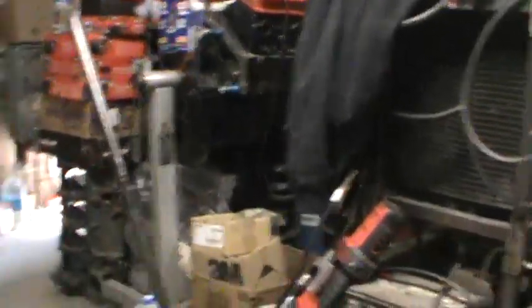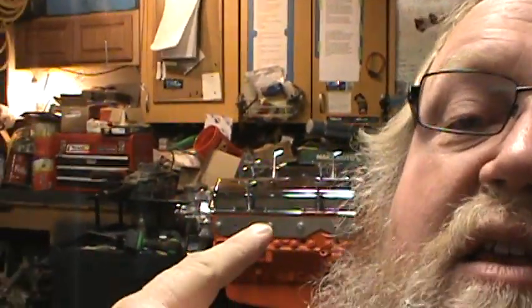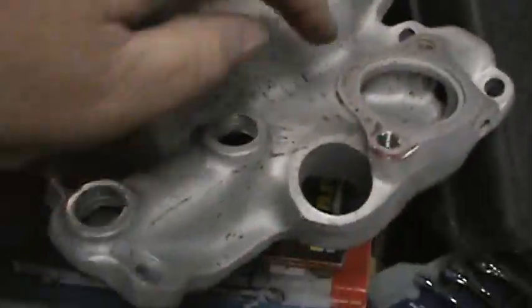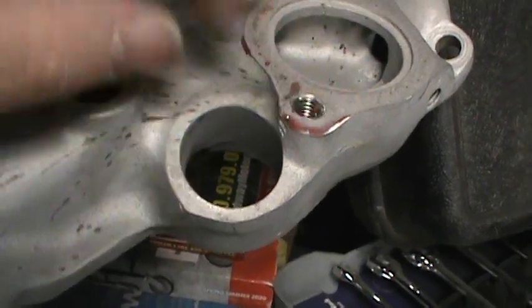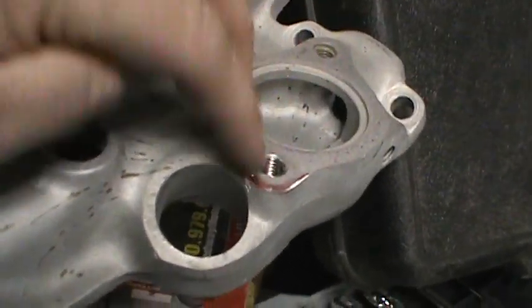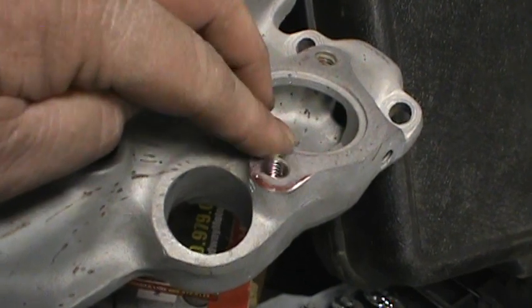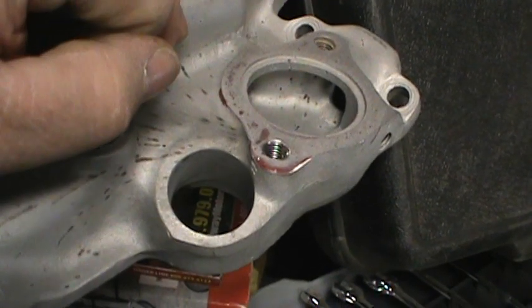I thought, well, I can sit down and do some welding. And I wasn't welding steel either - I was welding aluminum. This is the Offenhauser intake that I want to use on that motor there - the old hunting truck motor. Can you tell that I welded that hole shut, drilled it, tapped it, and put a helicoil in it? This one's a wet hole, so I wanted the helicoil in there so I'd have less chance of the thermostat housing bolt seizing in there.